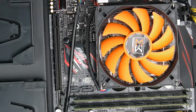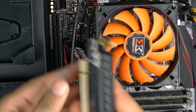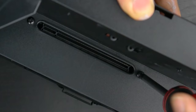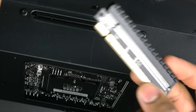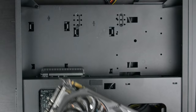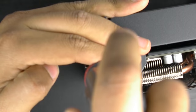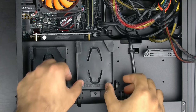Now it's time to install the GPU. Before installing the graphics card, we need to redirect the PCI Express connection to the other side of the case using the L-shaped PCI Express adapter supplied with the case. Connect it directly onto the PCI connection on the motherboard, then secure it into the case using Phillips head screws. Next, extend the PCI connection using the PCI Express riser adapter that also came with the case. Remove the PCI Express covers, and you're finally ready to install the GPU onto the PCI Express connector. Once seated, secure the GPU and connect the power connectors from the PSU to the graphics card.